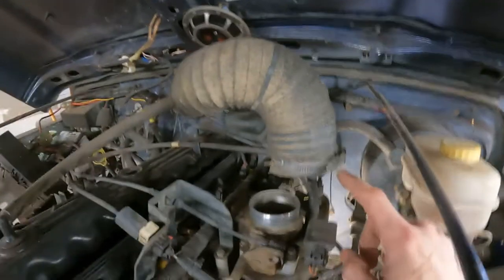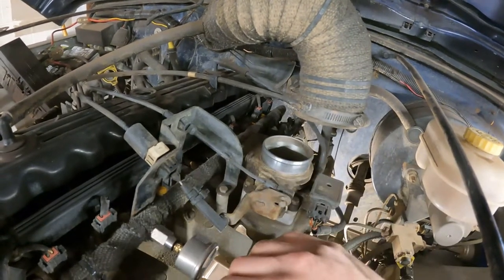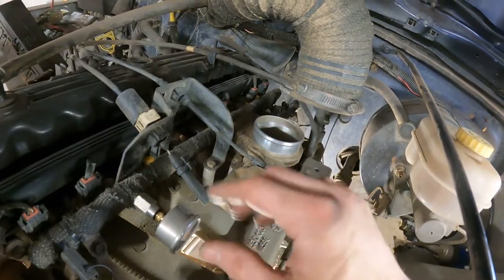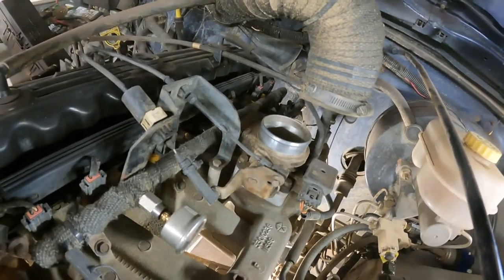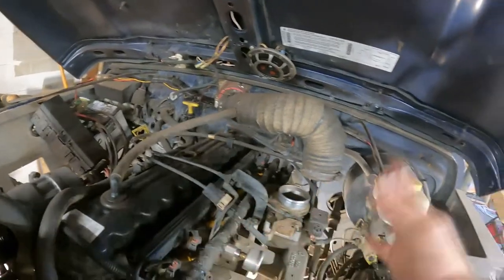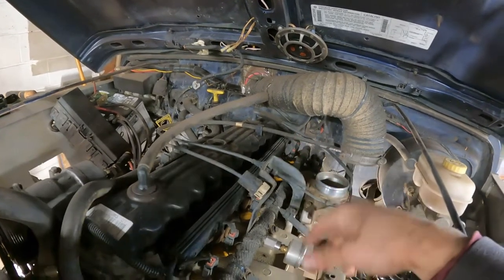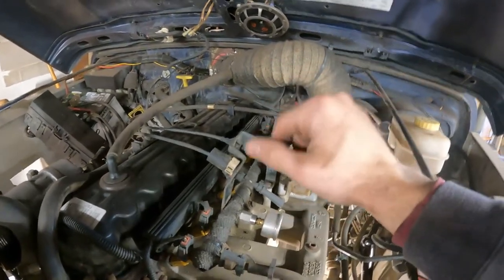The intake pops off easily with just a flat blade — not really anything to worry about there. Some other hoses and lines may have to get disconnected depending on whether you can sneak the manifold out through the bottom. The last one I did I couldn't get it out the bottom, so I disconnected the drive stuff and pulled the manifold off to the side, sneaking the exhaust manifold up through the top. I think I've got enough room to try the bottom first.